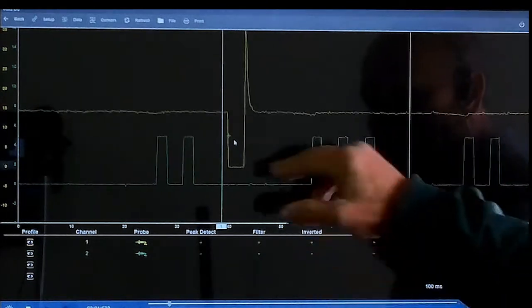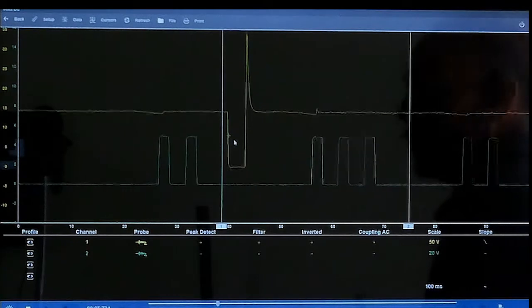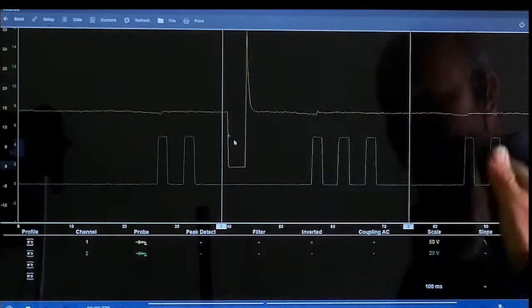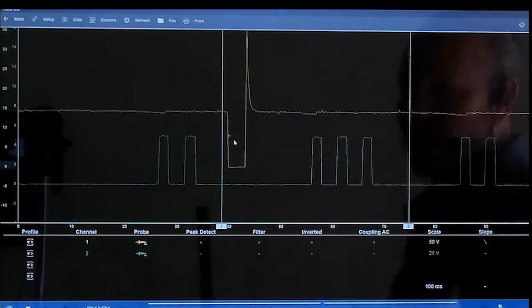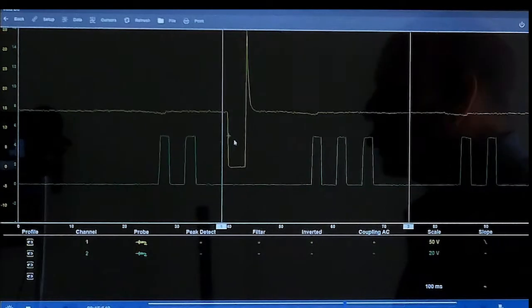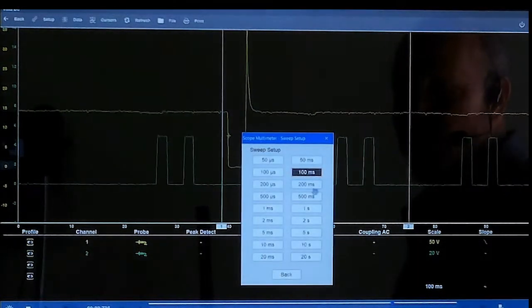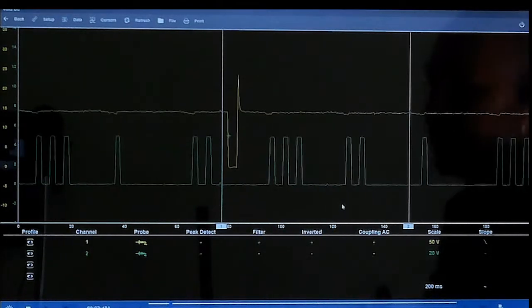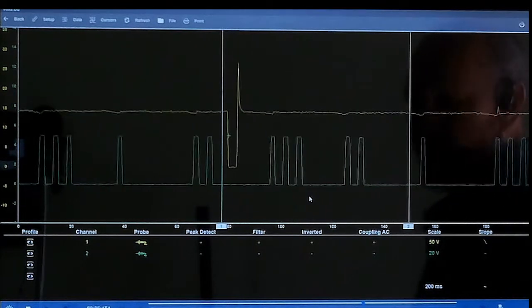And you can see that the voltage is down here, so we have our plus sign above that voltage, and that's why it's steady. But also it's keeping time because we're using the number 1 trigger, whatever injector it is, and that's keeping your cam sensor in time. So if I wanted to see more of it, I can see exactly when that injector hits to your time. So this is pretty much the basic parts of using a scope.